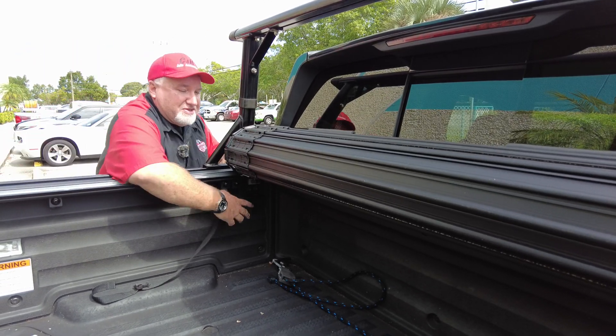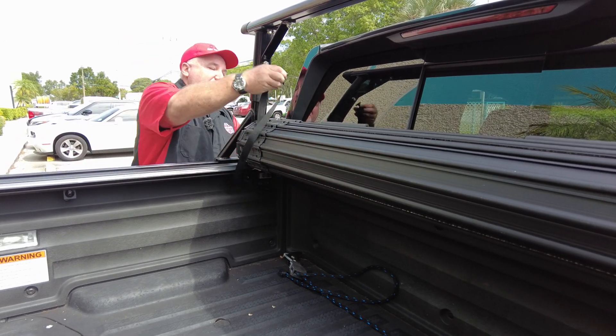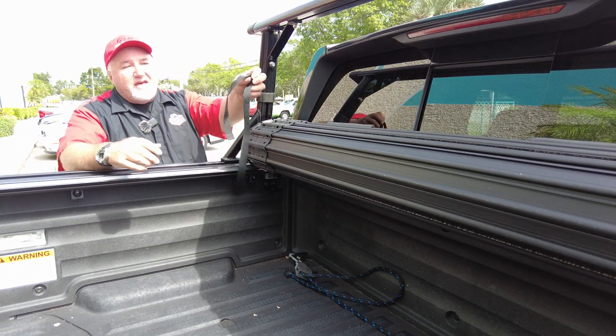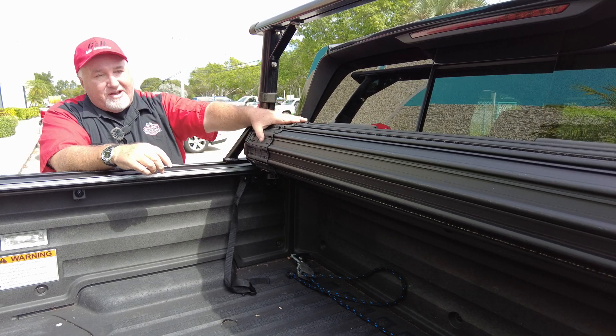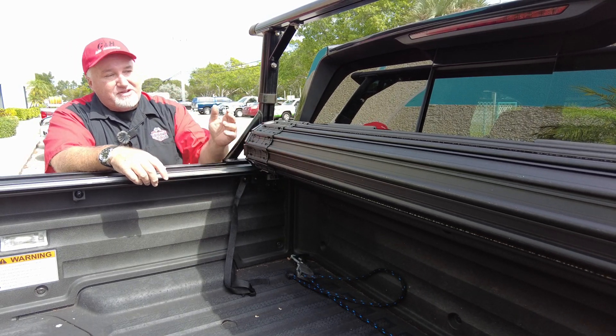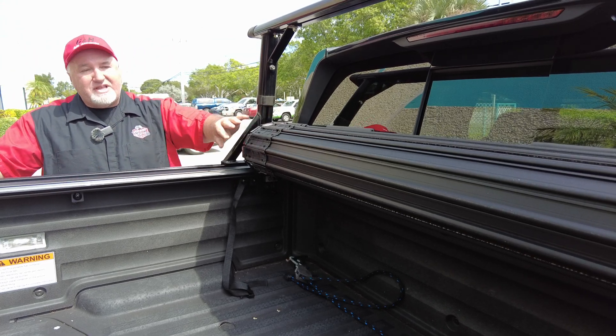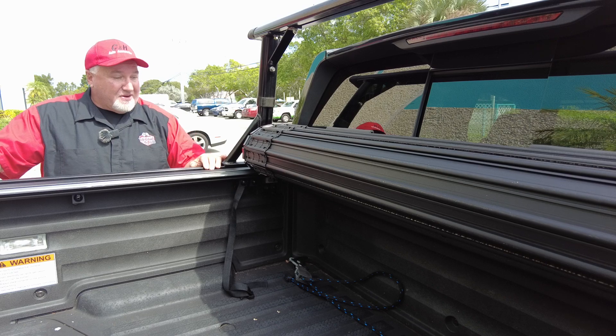Now, if you reach in here, you'll see this — it's just going to go around there, and there's a little loop. It goes in and you just turn it and tighten it up. I do recommend securing it. I've seen people leave it unsecured and as soon as they drive off, it starts rolling back on its own. So you do need to secure this. For the video, I'm not going to bother because we're not driving anywhere.